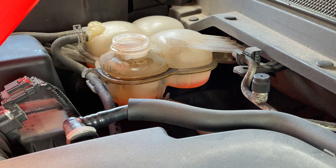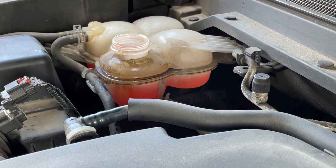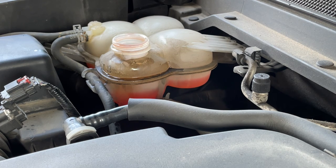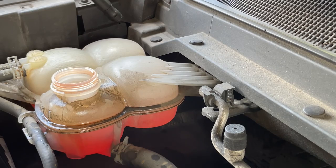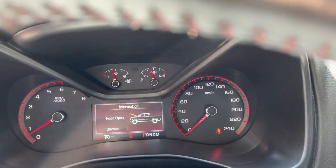Going for a 60/40 coolant-to-water mix. I'm squeezing the rad hose — you can see all the bubbles coming out. Squeezing and holding the upper rad hose works best. Starting her up to run it up to temperature. We're pressurized, got the fan going, truck's been running about 15 minutes, right at operating temperature. That's going to do it for this episode of Steve Does Stuff. Got about a 60/40 mix of straight coolant and distilled water — should be good for the next five years. Hope this helps somebody out there!